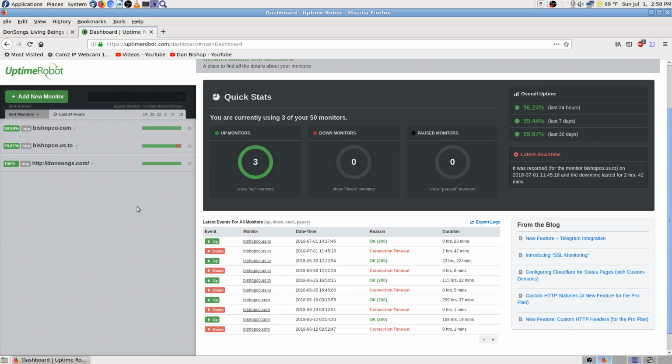But then, the Linksys, I recently put DD-WRT on it, hoping it would make it work right again, because it was getting to where it wouldn't work. One of the Ethernet ports is dead. The Wi-Fi was weak, and it's still weak. It would get 54 megabits, and it used to always get that. Now it was getting about 15 out there since I set it up out there. And that's what it was doing before I put DD-WRT on it too.